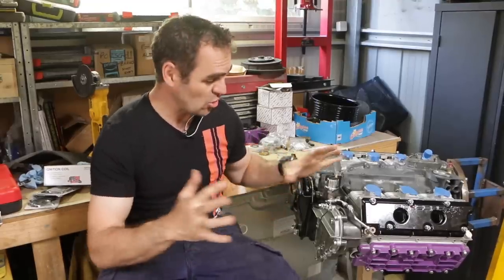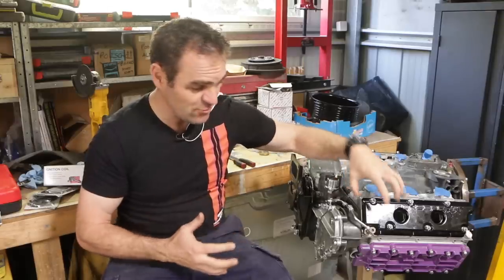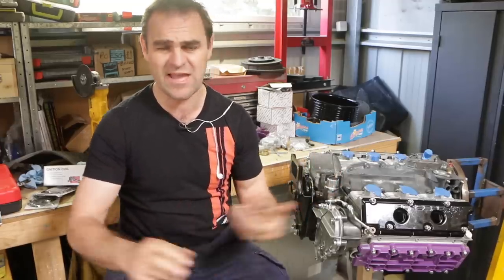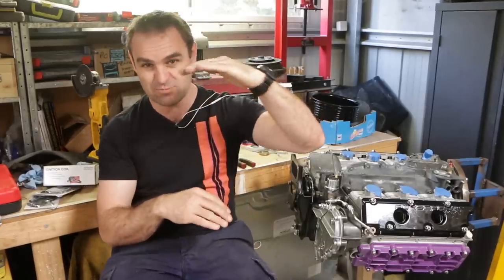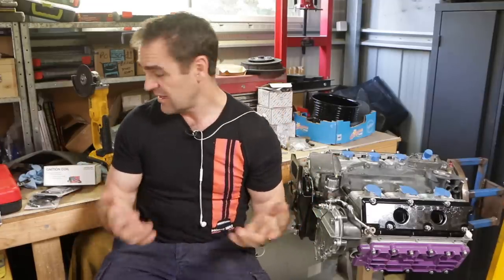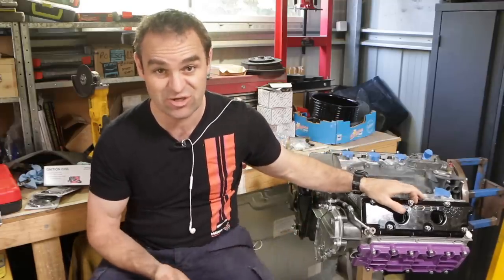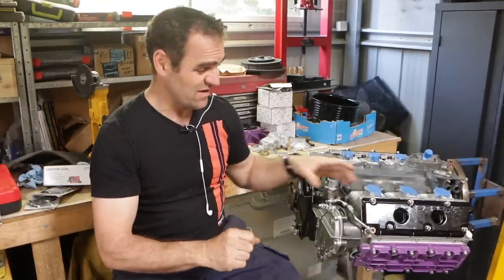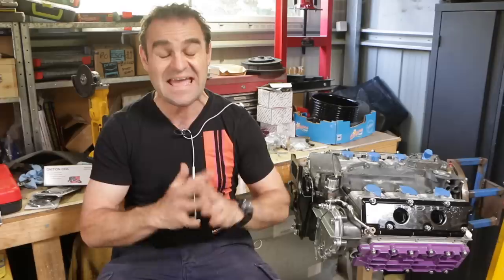So we're going to talk about the ignition system I'm going to be using on this engine. One of the things, as I said, is that they need a really big spark and you can't compare it to modern engines. Some people say coil packs would be fine — they're good for a thousand horsepower on an EVO — but that's a completely different engine with a completely different combustion chamber. They generally have a much smaller dome and a center-mounted spark plug, giving much better spark coverage. These engines don't have that, which is why you really need as much spark as possible, and the best thing really is a CDI unit. With a good CDI unit you can boost output to around 115 to 150 millijoules per spark, which really helps burn everything and get the most power out of your engine.